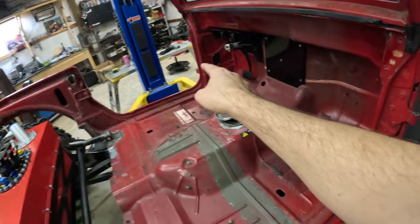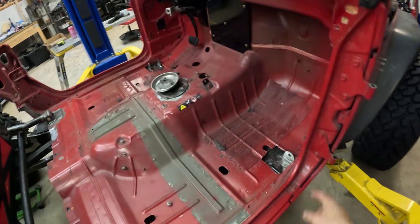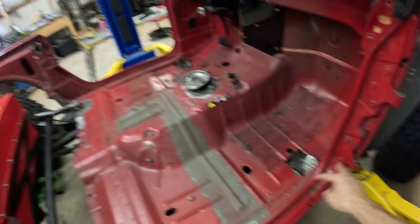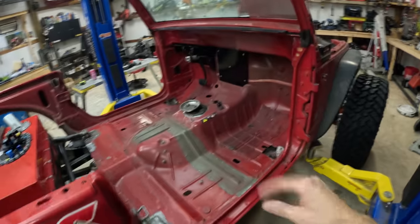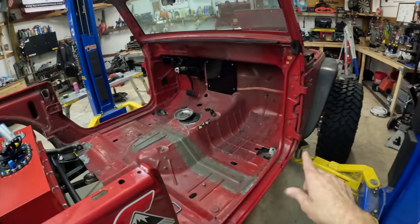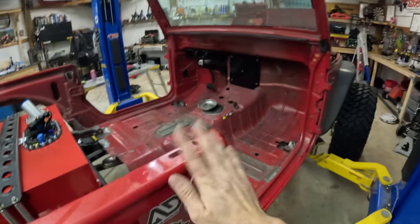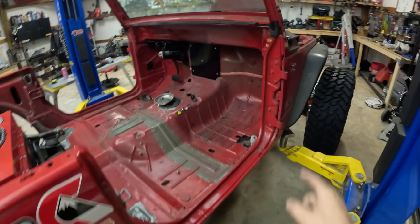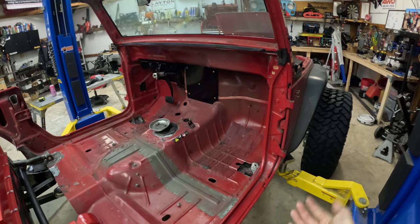We've already talked in a few videos about the plan for the terminal ends on the cage using leaf spring outriggers and a couple tabs. We're running a solid bushing setup that's going to allow us to remove this cage until final assembly. We can weld it in and box it in. In the event that we ever need to remove the roll cage for repairs or body swaps, all we have to do is cut those bushing legs off, pull the bolt out, grind the top off, and the cage is now removable - but it still meets Ultra 4 tech.